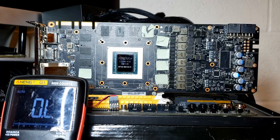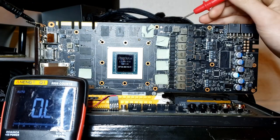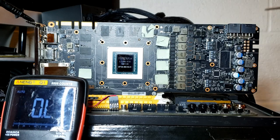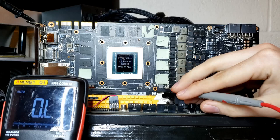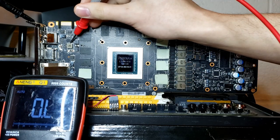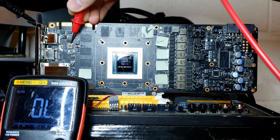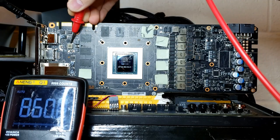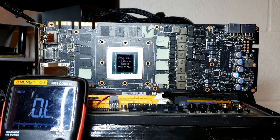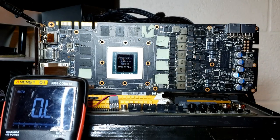Let's first check the memory phase — we have 88 to 89 ohms, which is a good sign, exactly what we want to see. Now let's check the PCI Express rail — 72 ohms, also a good sign. Finally, checking 1.8 volts — 850 ohms. In my experience, the 1.8 volt rail on a 1080 Ti is often around 850 ohms, while on a 1070 or 1080 it's usually around 900. So that looks good. I'm going to take a guess that the GPU is in perfectly good health despite the short on 12 volts.